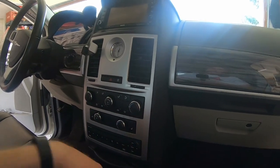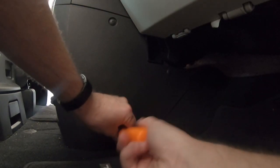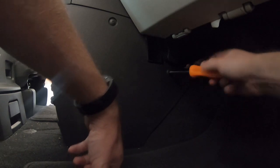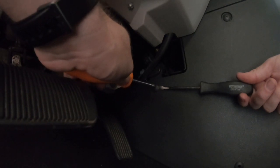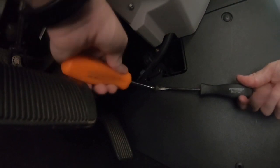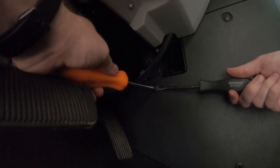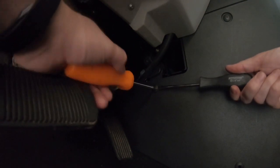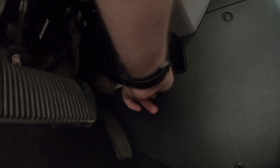it's time to remove your DVD player so we can repair it. I'm going to start removing three Phillips screws — one here, one down here, and one back here in the back. Moving to the other side, there's three more to remove. If you have one that's difficult coming out, one thing you can do is get a screwdriver behind it and lift up on it until it starts wanting to come, and then you can get it by hand after that.